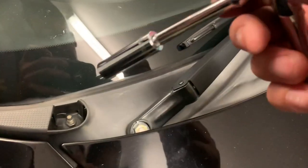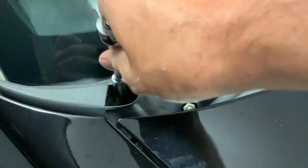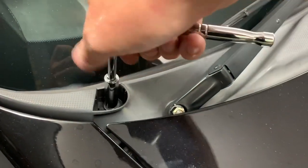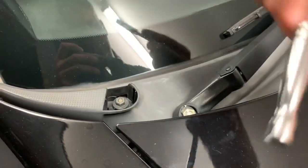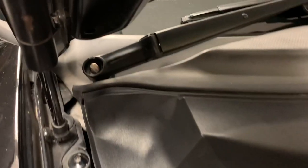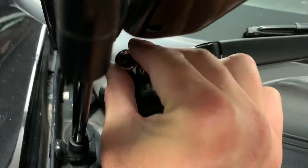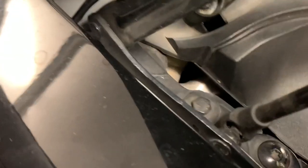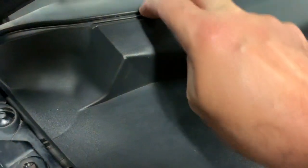That way when we put them back on we know what angle and what spline they're going to sit on. The nuts in here - everybody's favourite size - 10 millimeter. They're barely on so you don't need to torque these down very hard, they're quite loose since you're just holding plastic. The nuts on the arms are 13 mil - it's tight, you don't need an extension but you can get a ratchet in there no problem. Be careful you don't drop the nut down the hole.